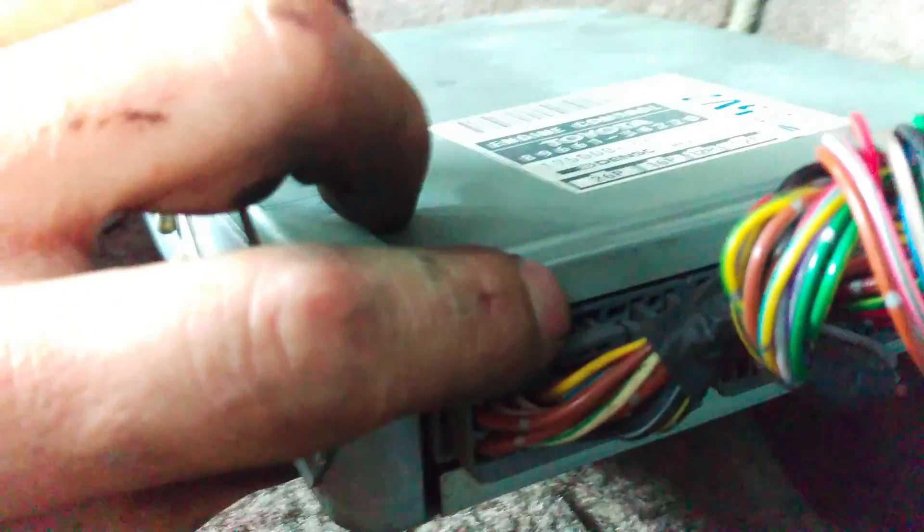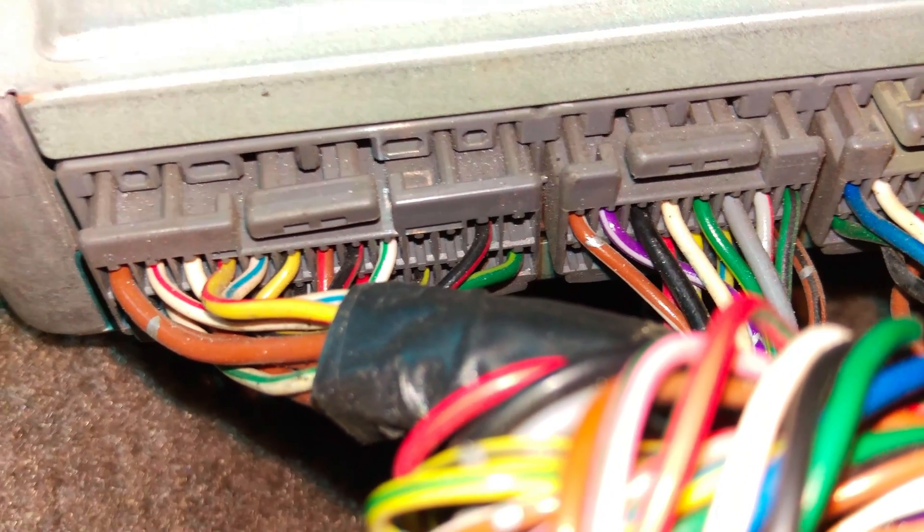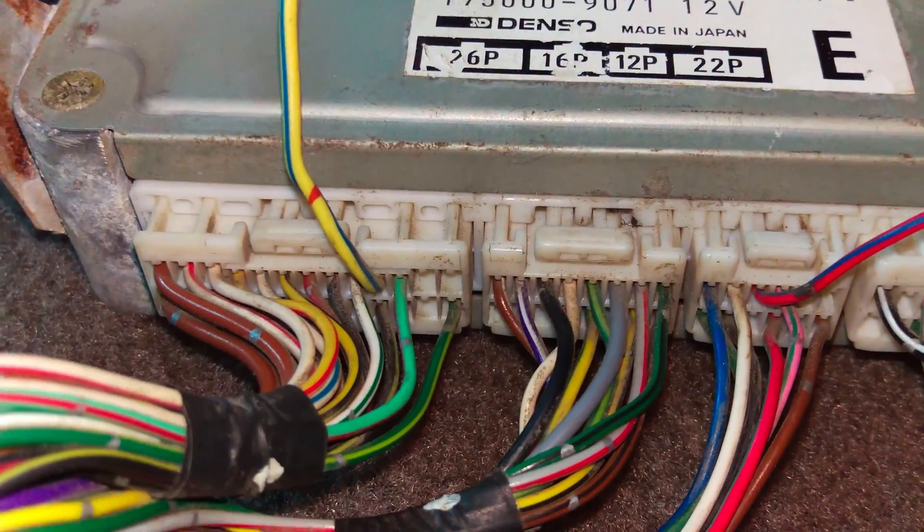The other ones I was talking about — the red/black and black/red — this is the D plug, the longest one. The first one is 2D, which is the black/red. You can see that upper right corner. So there it is on our 96 ECU — that's the one we tapped into for the vapor pressure sensor. And on this 97 ECU it's not even there, so it doesn't use it.